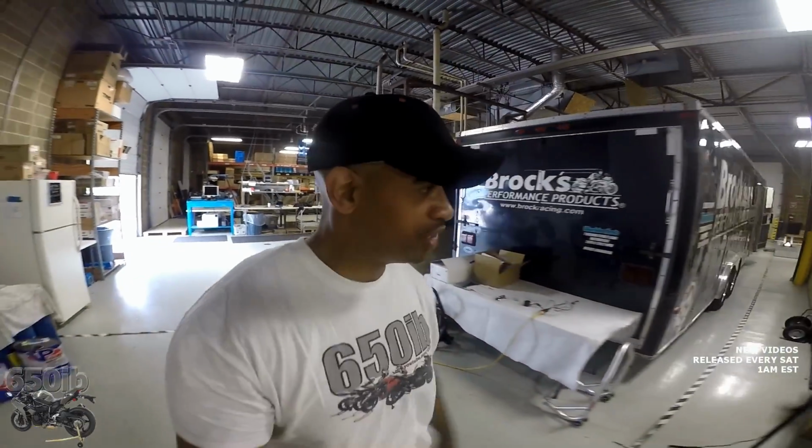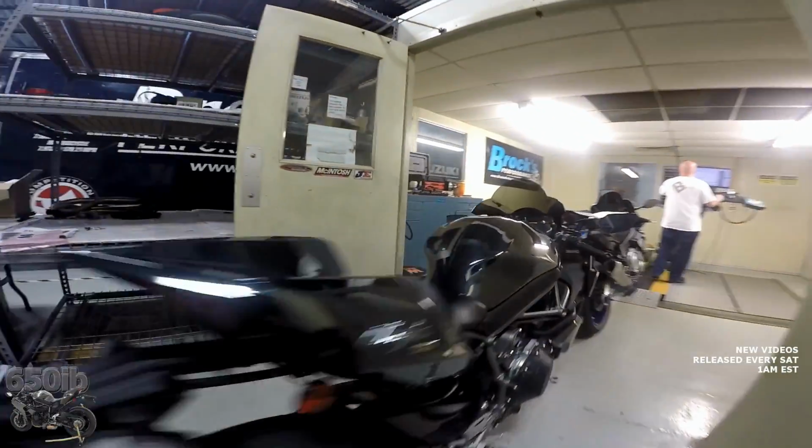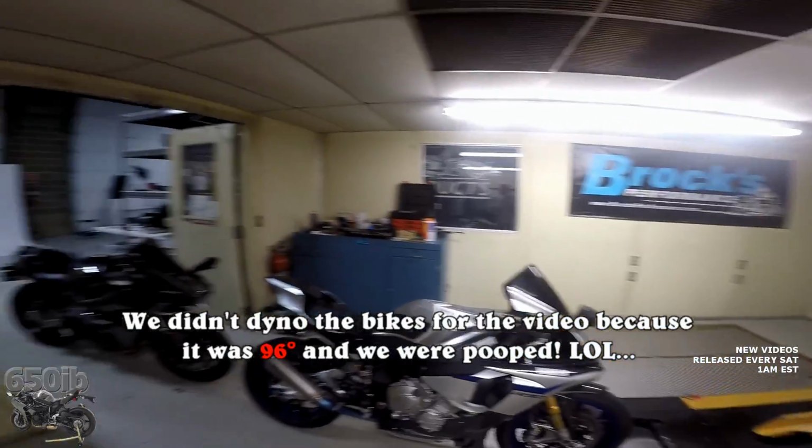Okay, we're going to have a little discussion with Brock here and talk about why I brought my R1M and my Ninja H2 to Brock's Performance for him to do the work on it. Well, we've got the R1M here. When I brought it in here, the throttle was extremely choppy. You may have seen from some of my track videos that I struggled on the track with just keeping the throttle consistent at about 4,000 RPM all the way up to maybe 8,000. If I held it steady, it was just completely choppy. And that's one of the things I wanted corrected from Brock.